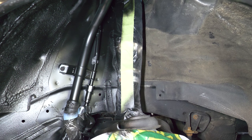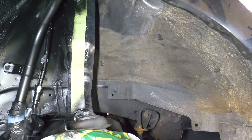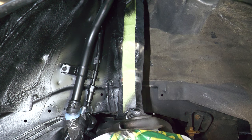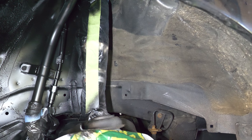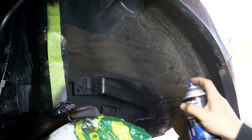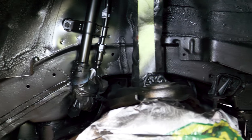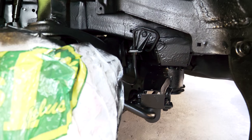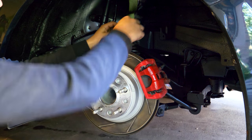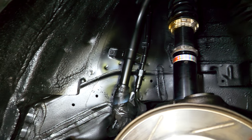If you had to choose for your car what side would you rather want? Would you want this left side that's nicely coated and painted nice and black, or would you want this side that still is black and brown and gross and still has a little bit of rust? I think it's pretty obvious as to which one you guys would rather choose. So this was about five minutes with half a can of paint, and I'm going to continue on to do the exact same process to everything over here. I'm going to be going over everything, making everything nice and black, painting anything that's rusted, and once you're done everything should look brand spanking new. You're gonna let this sit for a couple minutes between each coat - about ten minutes - go on for a second coat, finish up with a third and call it a day.